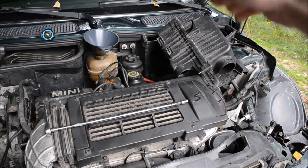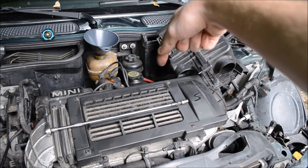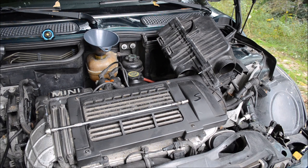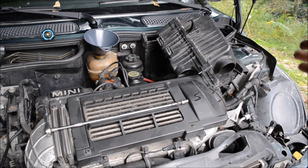There is another drain plug on the back of the block under the exhaust manifold, like behind the starter, but don't even worry about it. Don't take that out. It's some kind of special bolt that you'll ruin if you take it out and you need to put in a new bolt. So just letting you know, but warning you not to bother with it. Now you can reattach all your hoses and reinstall your air box and then start filling.